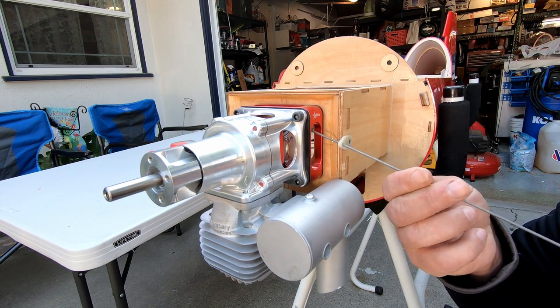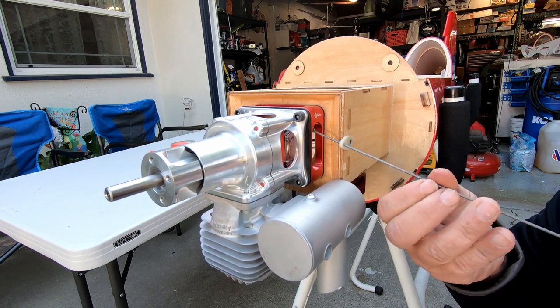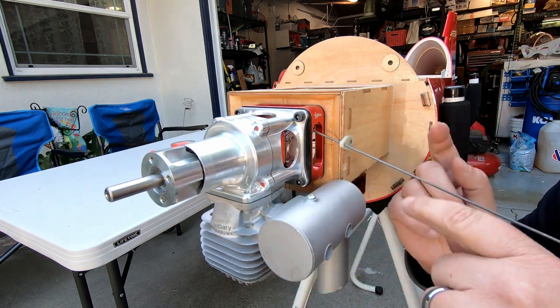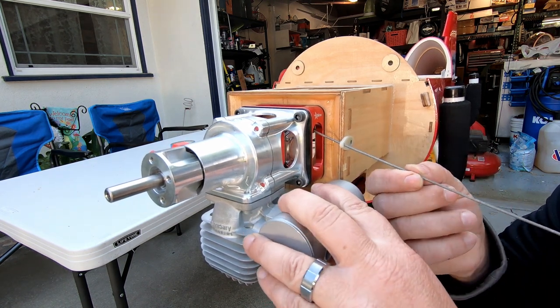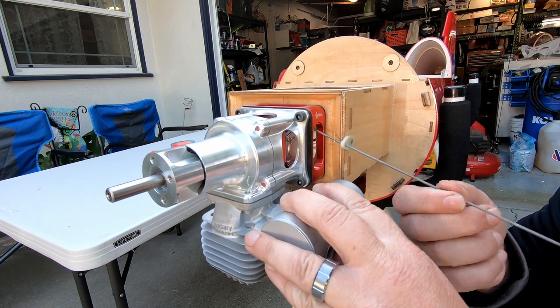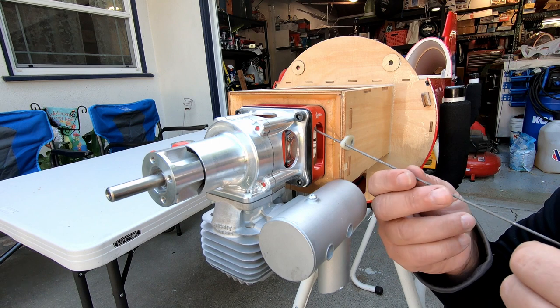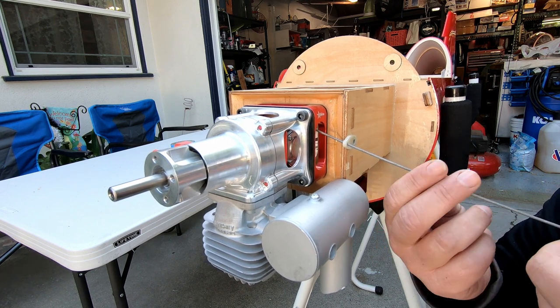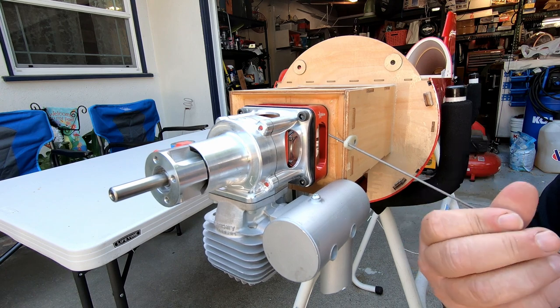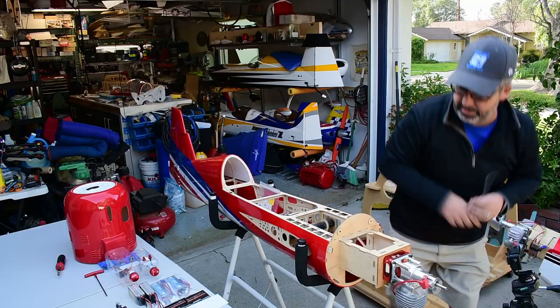So now we put this in here and screw it in to that side — it's really long right now so we'll be working on this. So now you can see we've got a working choke rod: choke on, choke off. So how are we going to transfer this over to our cowl? I showed you guys how to cut the cowl for the engine — we're going to use a very similar process.